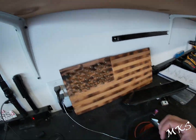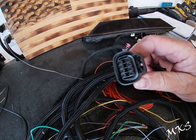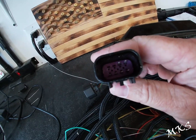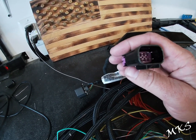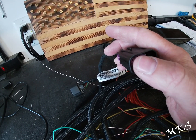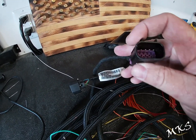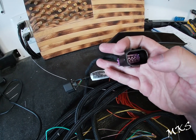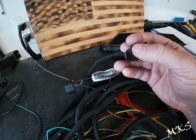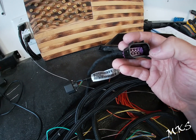Okay. All right. So the I551 connector is a female connector, so you will need to get the male plug and then pin out all of the connectors inside of it. There are 2 that you will see in here that are absent. Those are the 2 for the lock cylinder on the tailgate, so you won't be using those. The way that you read this connector is pin A is in the upper right hand corner, and then it moves across in the first row, A through D, and then continues on to the bottom, so on and so forth.